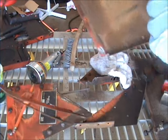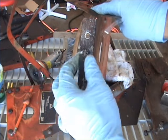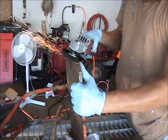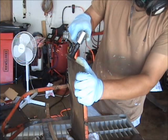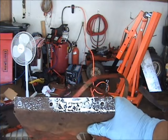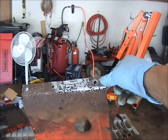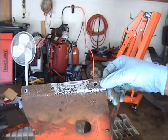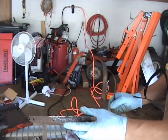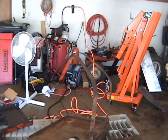I cut out the rust and I've welded in a little patch right here. I'm in the process of grinding it, trying to get the weld smooth. I've ground down the weld — not too bad, all the marks from the rust. I'm going to put that phosphoric acid on here, let it get all through everything. After that I'm going to fill it in with some all-metal or body filler to cover up all the little pin holes. It's a little hard to weld on pitted metal, but you've got to do what you've got to do.